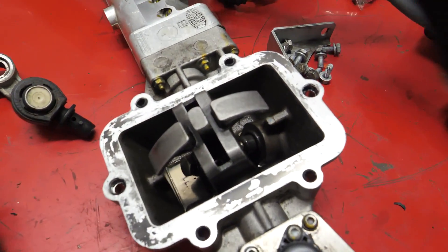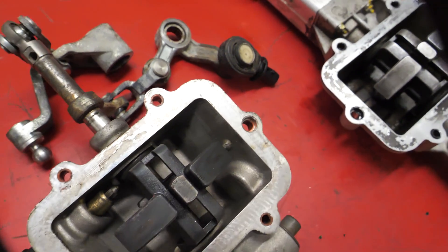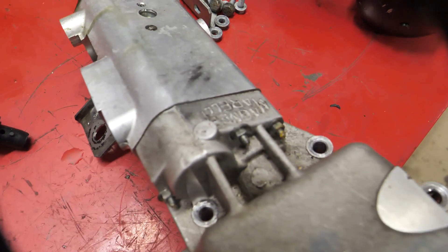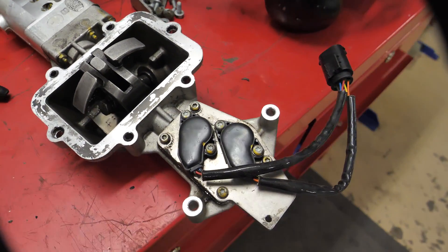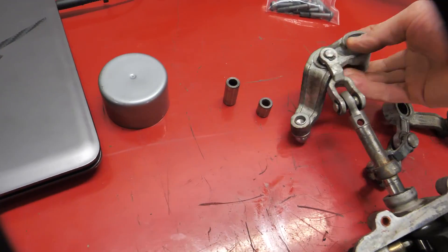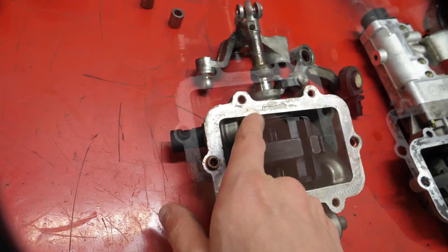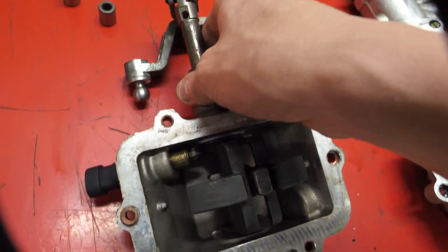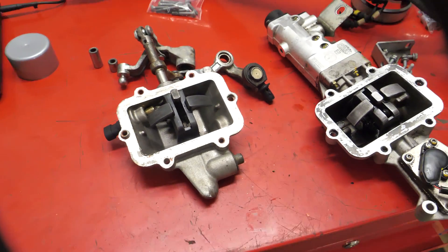Here is the shifting mechanism I just removed — this is the hydraulic one, and this is the mechanical one. The gearbox is basically the same but the mechanism is different. The one I'm removing is the hydraulic one, made by Magneti Marelli. It has inputs and hydraulics that move the mechanism, with sensors in the back to sense gear position. The manual one uses mechanical linkages that make the mechanism go left and right. This is also the switch for the reverse gear, for the rear-view camera and reverse light.